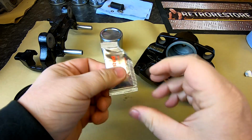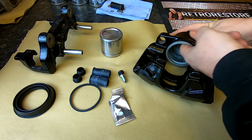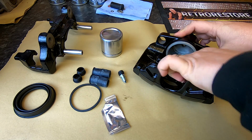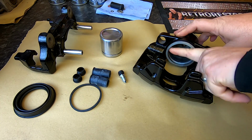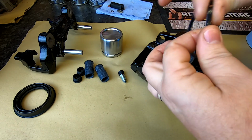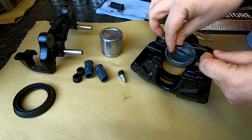And first of all, as I say, I'm just going to smear some red grease. Well, it's not red actually. Look, normally it's red. Just inside the piston body, just so that the walls are all lined with a thin smear of grease. It just helps when inserting a piston. Around the slot there, what the seal will sit in. Seal as well, and put a bit on there. Just make sure it's nicely lubricated, because we don't want this snatching when we go to put it in. And literally, that's it. So let's just put that inside.